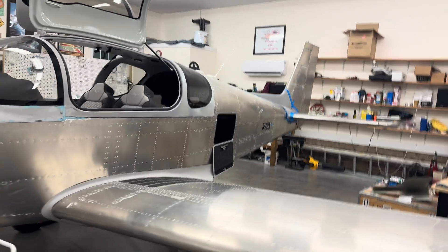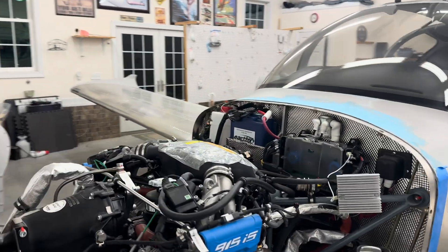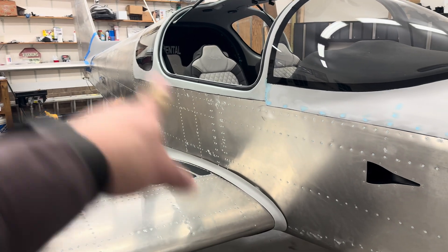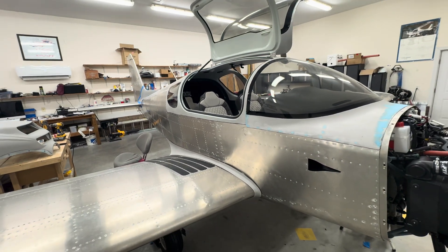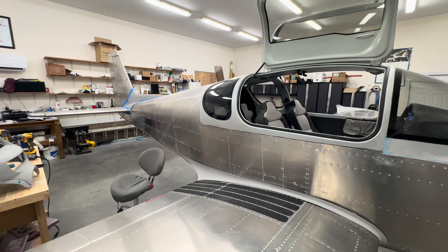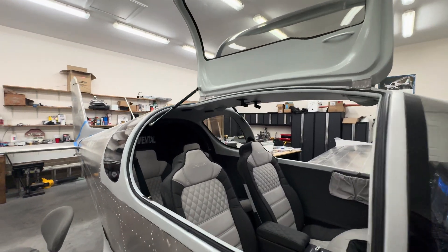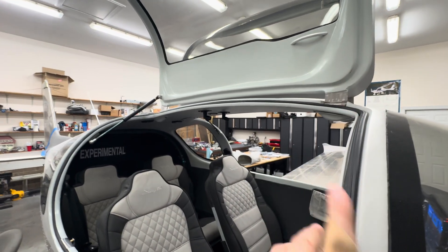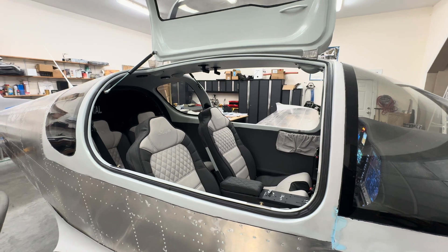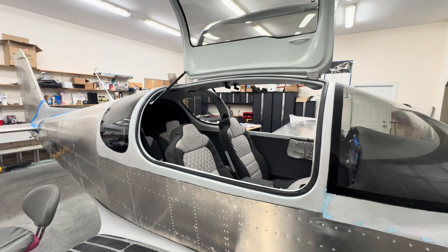It's just lots of little odds and ends. We're getting closer and it's getting exciting — I'm hoping I can finish this out in the next few weeks. The wheel pants and the wing and empennage fairings are what's left to be done. Then it's just down to some punch list items. I need to let a little more air out of the pistons on the doors — it's too hard to pull the handle down. I hadn't really sat in the plane and tried to experience that until just the other day, so I need to let some of the compressed air out of those gas struts.